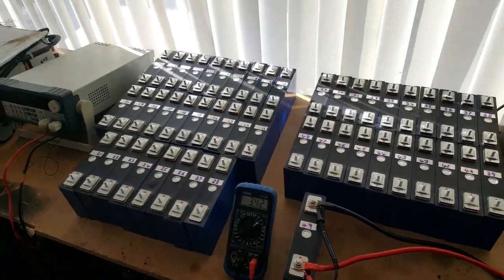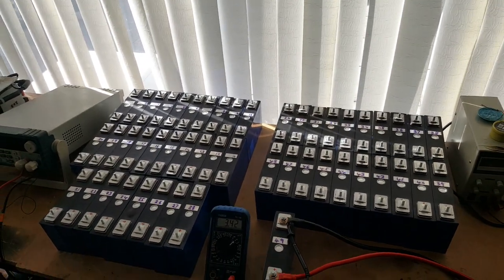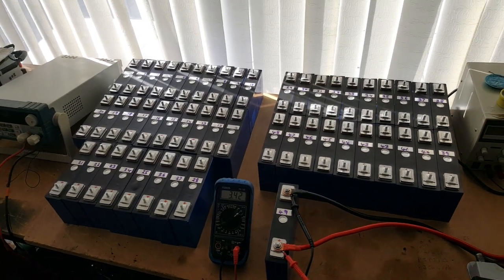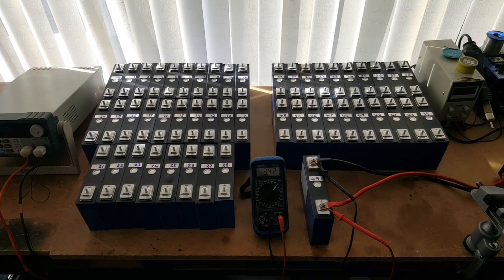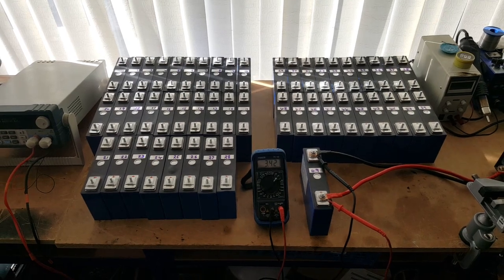I'm going to be on hold for a few weeks while I'm away, then I'm going to use an Orion 2 BMS — I've got an Orion 2 commercial BMS somewhere in one of my boxes. It's a 60s BMS so it'll be fine for my 48 cells. It's a quite capable BMS and should keep a close eye on the cells in use. I'm probably only going to use them between 10 and 80% or 10 and 90% state of charge, and won't be using the full pack capacity unless I absolutely need to.